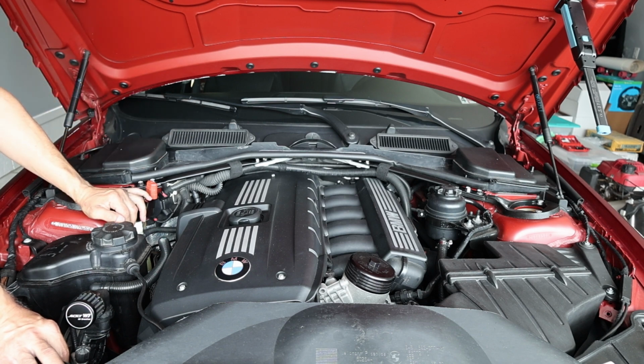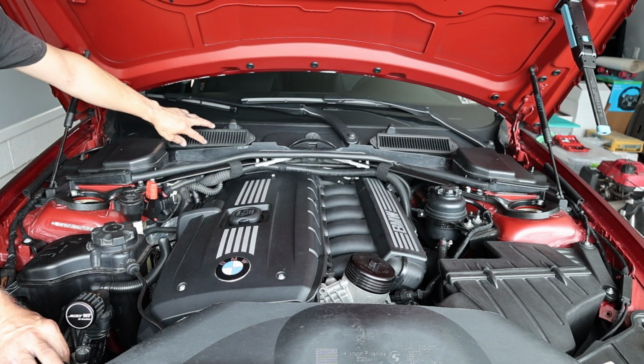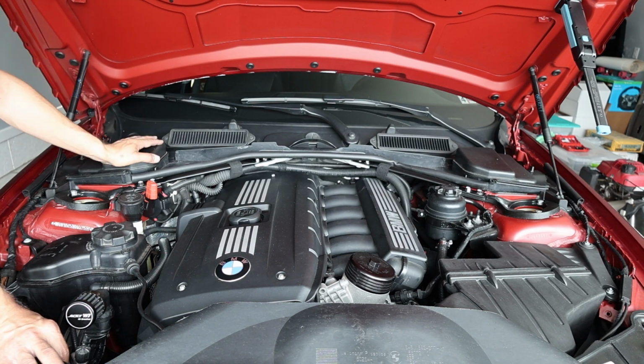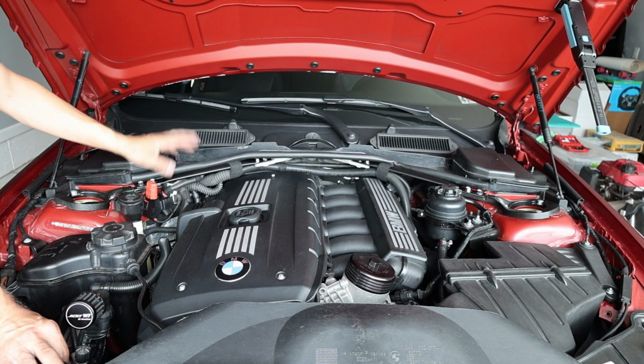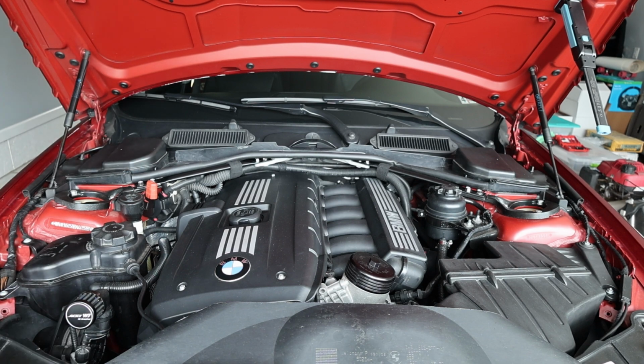There is a downside to this, actually. You will have a bit of hot air coming out of the engine, and it's going to start getting into your AC and ventilation system. I guess that's a good thing if you're driving in winter time, you will have some warm air coming in. In the summertime, I guess that's going to be an extra strain on the AC system. Well, I guess that's pretty much it. That should conclude this job.